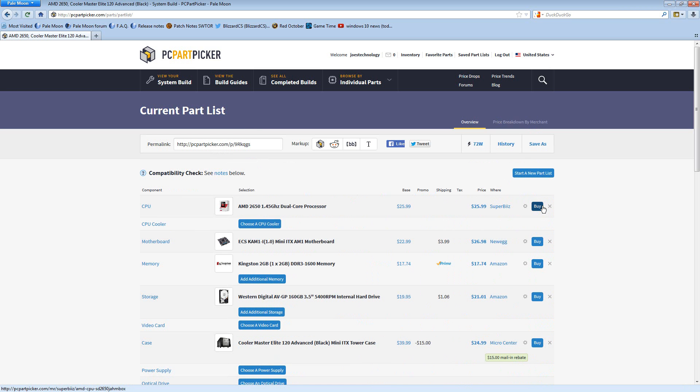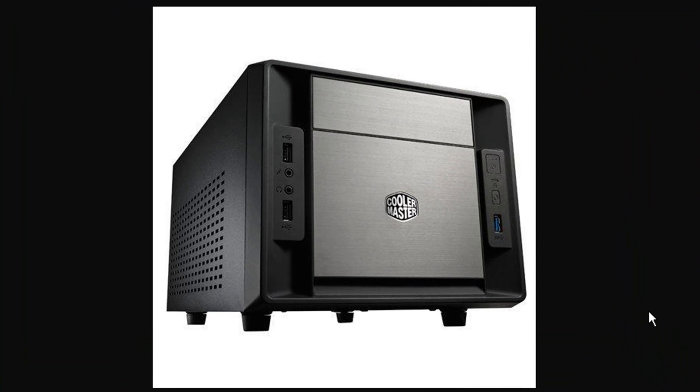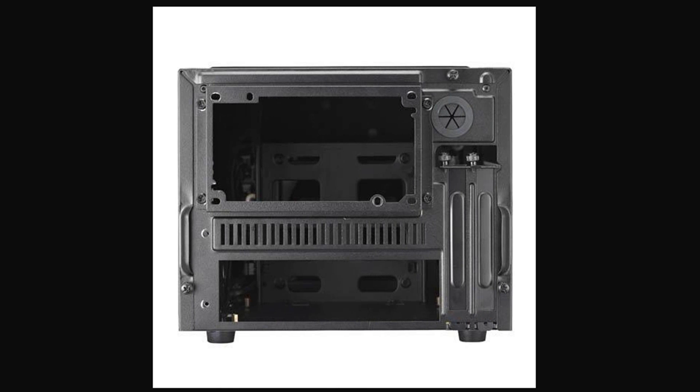What I really like about the Elite 120 — looking at some photos — it looks nice on the front and it's got USB. Keep in mind there's going to be a warning that appears: it has USB 3.0 on the front, however this motherboard does not have connectors for front-side USB 3.0. You'll probably see PCPartPicker warn us about that. So you'll have a USB port on the front that doesn't do anything simply because there's no connection on the motherboard.